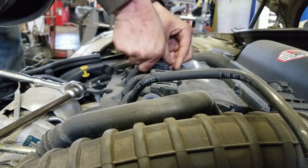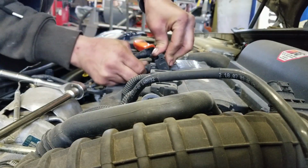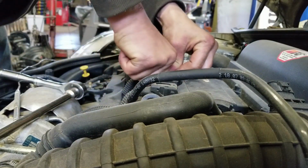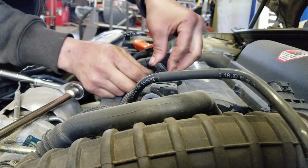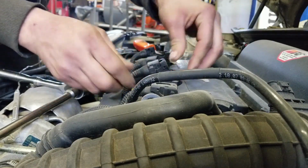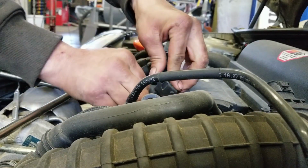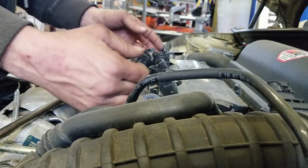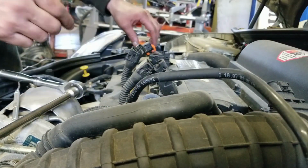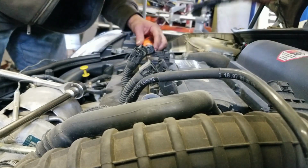And so we're gonna do this with all the coils. We're gonna get them all disconnected here, like that. Kind of pry under them, they'll release pretty easy, like that. And then, like that. Get all your wires swiggled out. Can't really mix them up, pretty easy. You gotta kind of twist them, pull your coils up, keep them all in order.